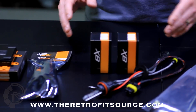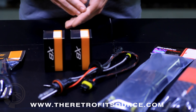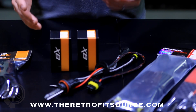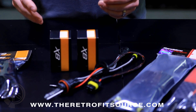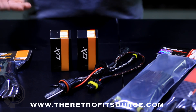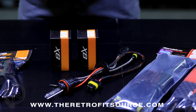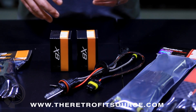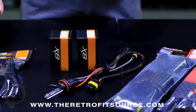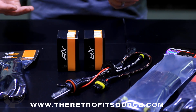Looking at bulbs themselves, we always have at least three options for Kelvin rating: 4500K, 5500K, or 6500K. Any vehicle from the factory with HID headlights comes with something around a 4500K. It's basically like a warm white light and produces a ton of lumens, about 3400 lumens. 5500K is going to be more of a pure white neutral light, which increases the contrast while driving at night without really drastically decreasing the amount of lumens from the headlight.